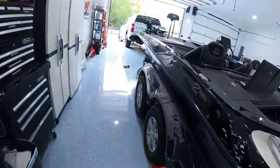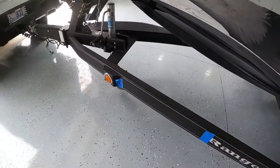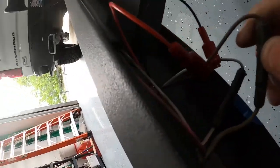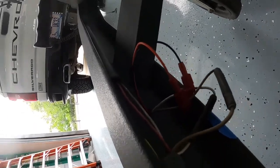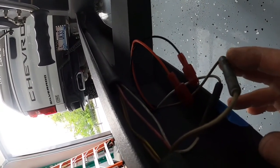What I've done here is I've taped the lights with some painter's tape to position them where I want them. Right here is my running light — on the back of your running light is a white and a brown wire. The brown one is your positive and the white one is your ground. So the splices go right into the running lights, and then the double stick tape will go along the bottom once I'm done. I'm going to test these out and hook them up before I do the double stick tape so I don't have to reposition them.